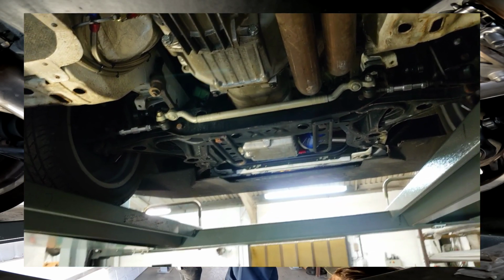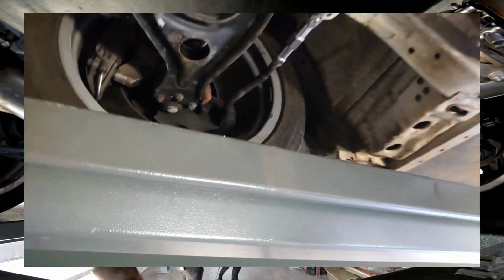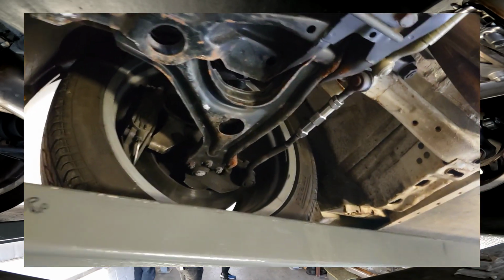So what springs and shocks are on it? At the moment, the reason it was quite skittish on the road is because it's got a track day setup, so the springs are probably 50% stiffer than your standard road spring. When we ran it in the desert, it was a much softer front spring, which actually also ran the car a lot lower, to the benefit of aerodynamics.